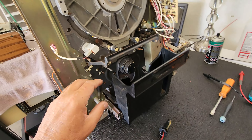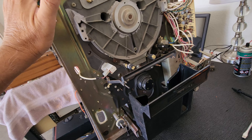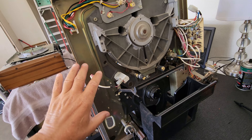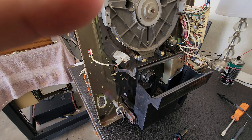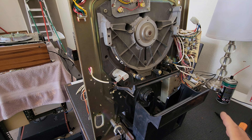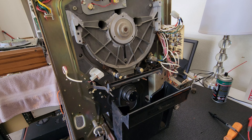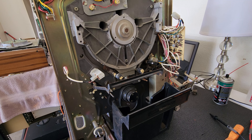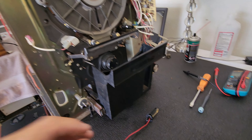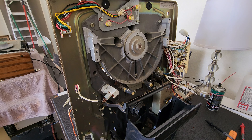With this photo sensor swapped, maybe we can get it to recognize the cassette in the compartment so it actually loads when you turn the knob. There's a major issue there, and I think it's the sensor — that's my best guess. I don't think it's anything electronic; I just think the sensor is not picking up that there's a tape in there. As I close it and put my finger over it in both directions, it just doesn't do anything — it won't go into the loading position. That would tell the system it doesn't see a tape, so when you try to turn it to load, it just isn't going to load the cassette. Hopefully swapping out the photo sensor switch will fix the issue.